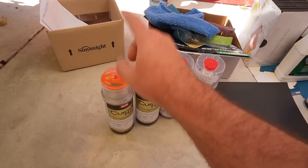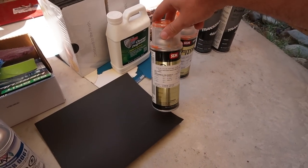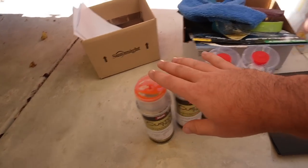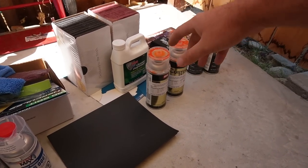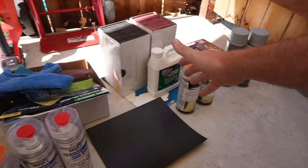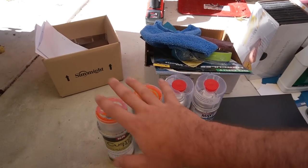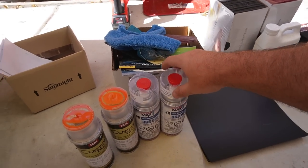It's going to be super sick. I want to have it made by yours truly since this is not made by BMW - they never made an E91 M3. The mix-up was I got this can first which came with clear coat and paint combined. A guy called 'V Tune' recommended I don't use the paint-and-clear combo - it's just not going to have as nice a finish, and if there are any mess-ups it's hard to go back and fix it, rather than just paint which we can easily fix and then put clear on top.